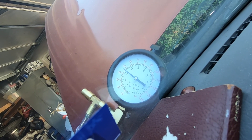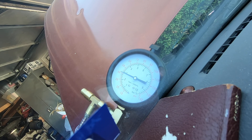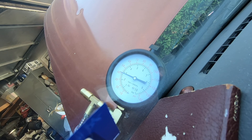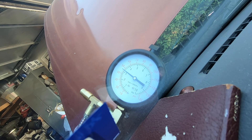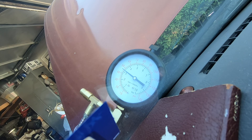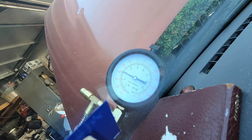I've got to look at the diagram and find out how this fuel pump is wired. When you kill the engine you should maintain fuel pressure, and it does. Even while running, the fuel pressure is within limits, although it's kind of on the low side — 44 to 50 psi is the spec for this vehicle while running, and it's probably about 46 to 47. It does maintain that, although it's boggy — you don't get instant throttle response. When you turn the car off it drops down to maybe 42 psi.